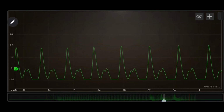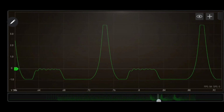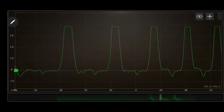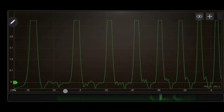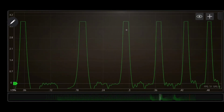Now we'll go back here to our snaps. So our snap throttle here, you can see our regular idling waveform, and then we start to get thicker and our pressure starts to rise up to atmospheric pressure down here. I wish I had my pressure transducer, and I do apologize, but I have these waveforms and I don't have the opportunity to take them again because the car is being taken apart. So you want these compression towers here to be 3 times taller than your idling towers. They should be greater than 3 times, but at minimum 3 times taller than your idling towers.